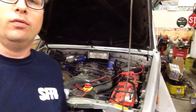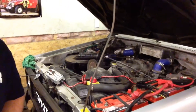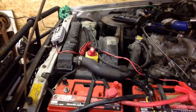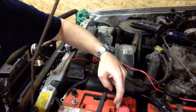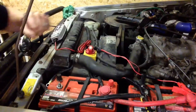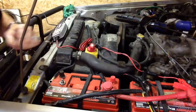Those two batteries are still 12 volts. So this battery setup, although there are two of them, they are connected in parallel. That means the positive post of each battery is tied to the positive post - positive to positive and negative to negative. I've got it disconnected right now because I'm running a desulfate cycle on this battery here. But this is effectively one big battery.